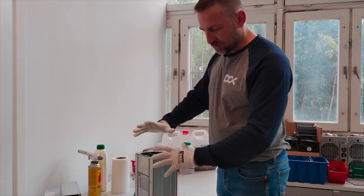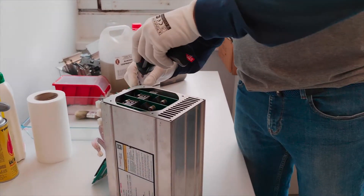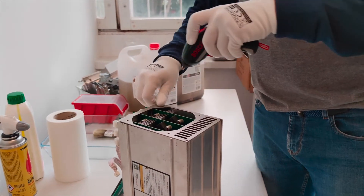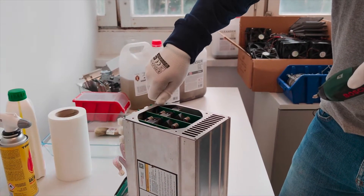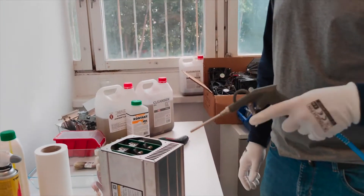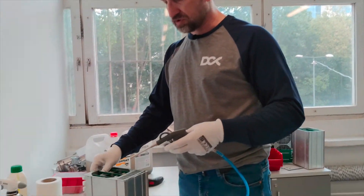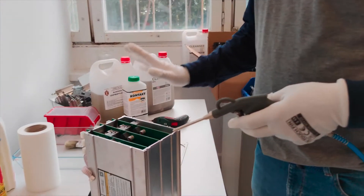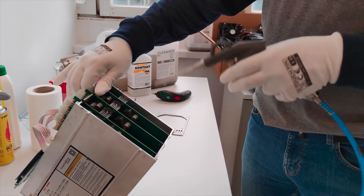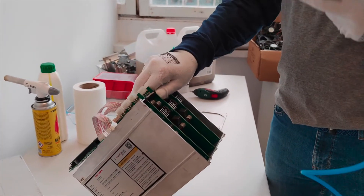So you have a single tube miner here, and what we need to do is first remove the hash boards. If the miner was previously used, you should first clean it with a compressor. There will be lots of dust at the very beginning, especially if it was already used — a simple compressor will do. You just take your miner, remove the parts you won't need — all those fans, all those baffles — and you clean it very carefully through all the miner's components so you remove all the dust you can find.